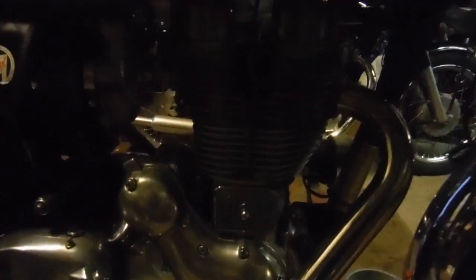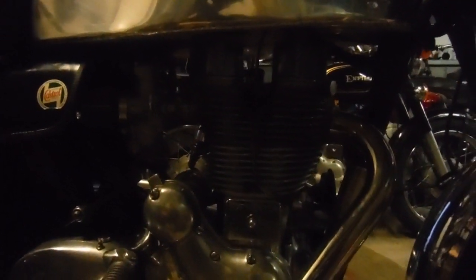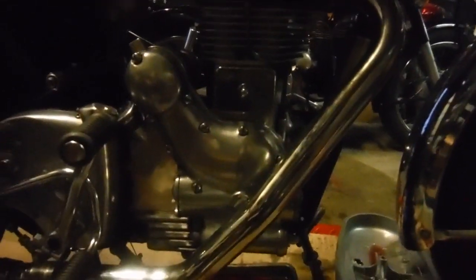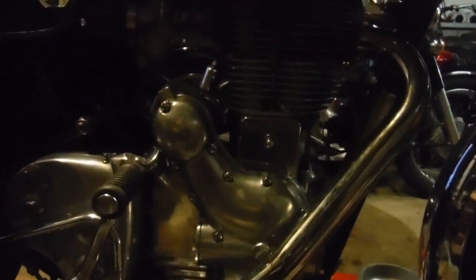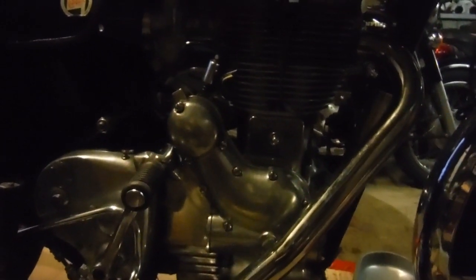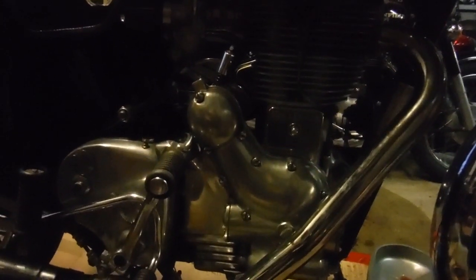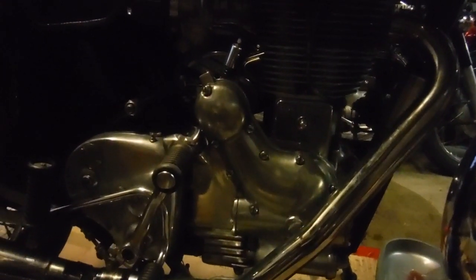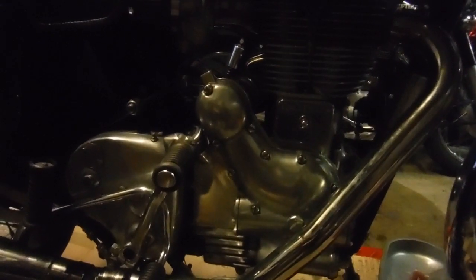We've got an aluminium cylinder barrel, which has been shortened by 2 millimetres. It's got the 9-to-1 American made piston in it. It's got the Hitchcock's competition cams in it, but I've had to retime them to suit my own needs. So the inlet cam is retarded by a tooth, and the exhaust cam is actually advanced by a tooth. So the dots on the cam wheels now are 2 teeth apart, they don't line up.